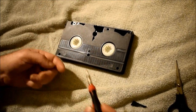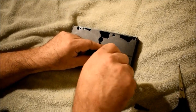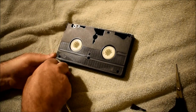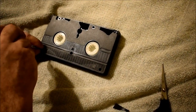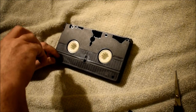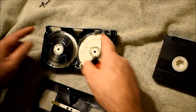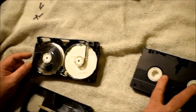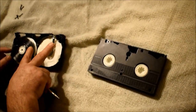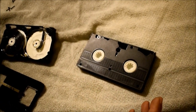The tape I used is pretty flexible and strong enough to make many revolutions. The other option, if a tape breaks in the middle, is to make a Part 1 and Part 2: take an old empty cassette shell, take the ribbon out of the reel, take the good reel from one side, switch the reels — put one side of the tape on one cassette and the short section on the other. If it broke right in the middle, you've got tape one and tape two, but you've still saved your precious memories.